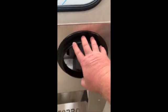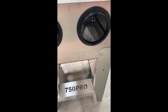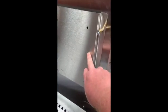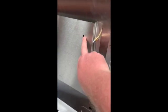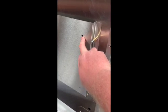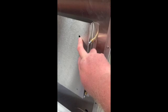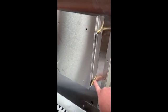Once you've folded the inside of the glove, the whole glove goes inside and then folds over and sticks. That gives you the area to slide the jubilee clip on and tighten up. Once they're in place, there's pretty much most of the cabinet put together. Around the back, you've got a tray that holds the electric cabinet in place. Yours will have pre-fitted blind rivets — what they're called rivnuts, which are captive nuts. All you've got to do is open the lid on the electric cabinet, bolt it to the tray, and pop rivet it into the back.